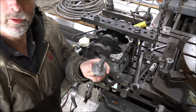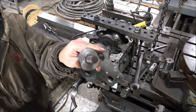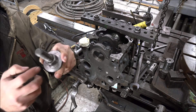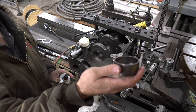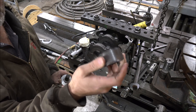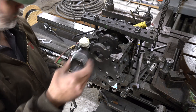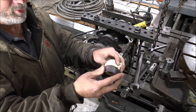Fortunately, I was able to grind these special two flats on here. That was enough to let me finally get this stuff down into the block to pull this bushing out. Got a nice bushing with the correct fit inside and outside, but it doesn't fit anything here. So that was a waste, because this is the bushing that belongs in here.